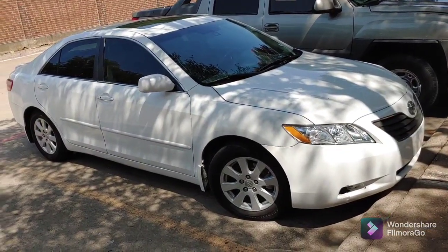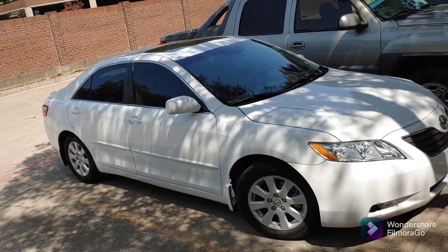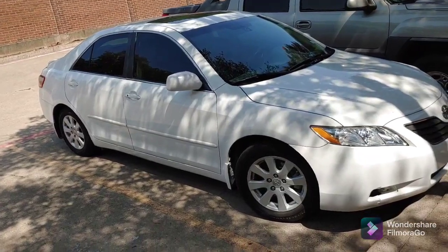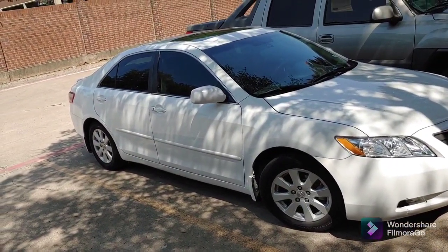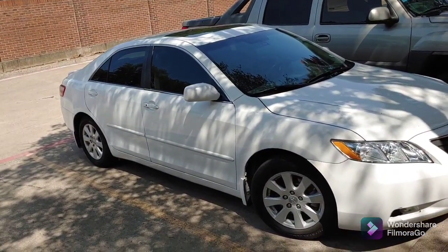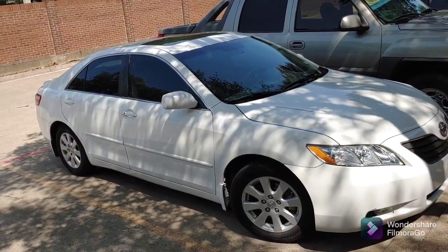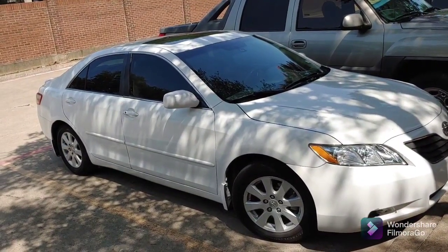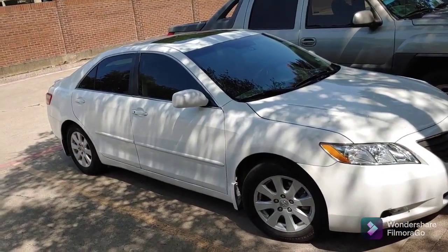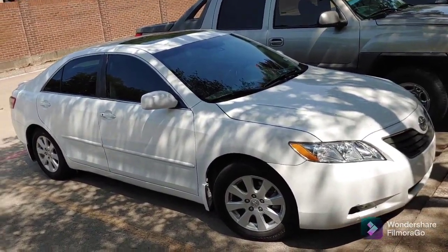For these it's a 25, and I highly suggest you use an absorbed glass mat — they're called AGM batteries. I use the Duralast AGM 25, group size 25. I got it at AutoZone for $199 and that worked just fine. I'll show you how to take that little temperature sensor off the old battery and put it on the new one. You get out for $200 rather than $400 or $500, and probably have a better battery.